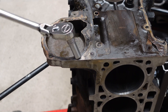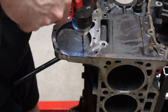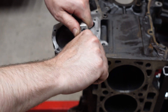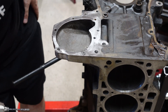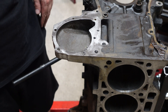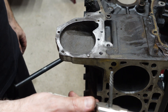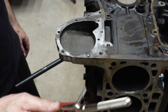So I thought, let's get back to basics. I ground the stud down a bit and tried to drill it out again. Another attempt with an extractor and nothing. Then I tried again, being as deliberate as possible a third time, drilling as deep and as wide as I could — and then the unthinkable happened. With my gorilla strength, I went too far and the extractor just sheared off right inside of the stud.